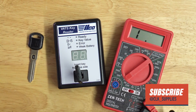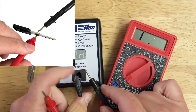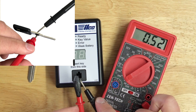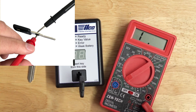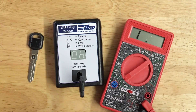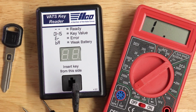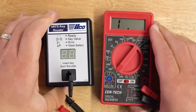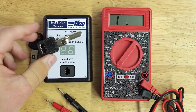Now for this single sided key, let's put the contacts on both sides. The reading says 52. Since it's set on the 20k setting, that means it's reading 520 ohms. The number 2 VATS value is 523 ohms, so we know within reason that's going to be the VATS value you need. And that is how you can calculate a VATS ohm value with a multimeter.